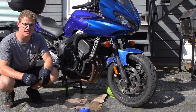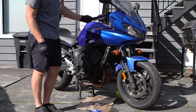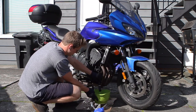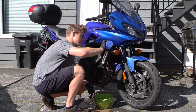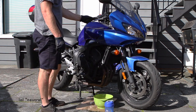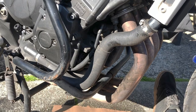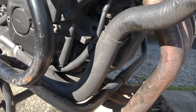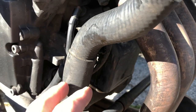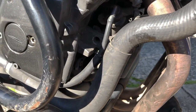After that we'll put it all back together and fill it with antifreeze, distilled water, and water wetter. Along with flushing and changing the main coolant, you also want to inspect and change the coolant that's in your reservoir. It's tucked behind the header and there are three bolts that hold it in, but all you need is to make sure it's between the min and max line and has some good quality coolant in it.